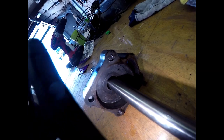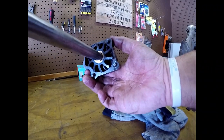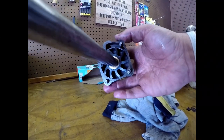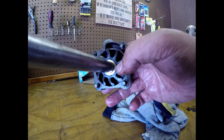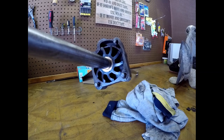Don't forget to clean your impeller housing as well — that's really important too. Clean it out, wipe it down. It looks pretty shiny. I don't see anything else in it that could cause problems, so we're just gonna go with it — put it in there, make sure all the fans are going the same direction, and just send it. Now we've got this installed in the housing. You want to make sure all your fans are turning in the same direction. It is a little difficult to get them all going the same direction, especially since every time you push down on it they want to go a different way. You want them all the same direction — just like that, that'll be fine. I did put a little bit of bearing grease in here just for initial startup, but after one trip out maybe five or ten minutes in the water it'll wash out.